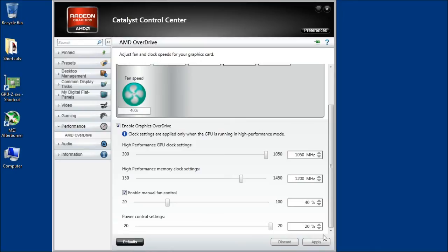If you see freezes, or a blue screen, or a black screen, or the computer restarts after 20 minutes of playing your favorite game, then you will need to decrease your GPU frequency by minus 10 megahertz. Just take away 10 megahertz and then benchmark and test it again. Make sure it's stable. If it's continuously unstable, back up by minus 10 megahertz more. Don't worry, it will not hurt your video card. It is designed for it.